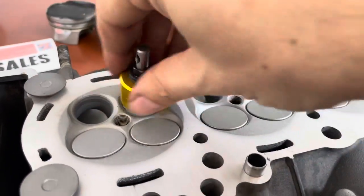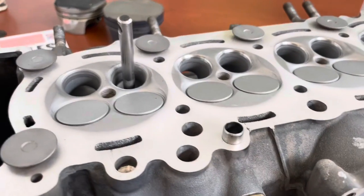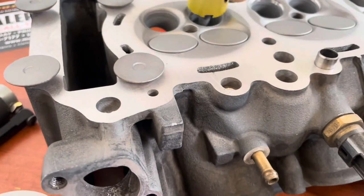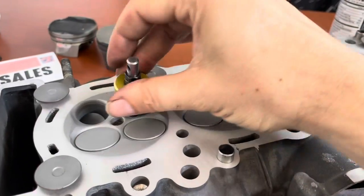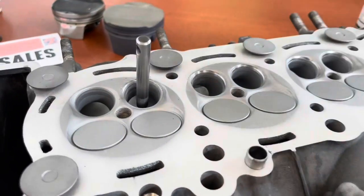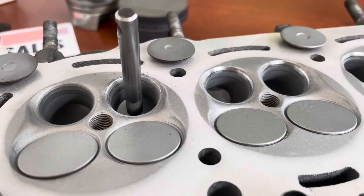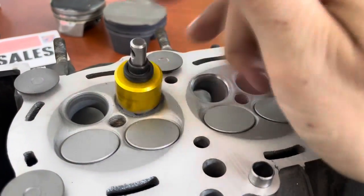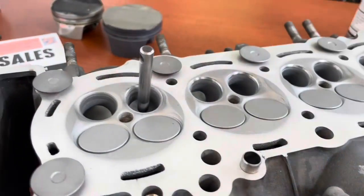These were already cut before, before coating it. Unless I choose to sink that exhaust valve a little bit — which we are probably not going to do, though I might — this one definitely doesn't need any extra pressure. Just the weight of it itself will create a shiny line right around there, so we know that none of that coating is left on there. We'll go and hit it with the 45 again, let the weight of itself do all the cutting.